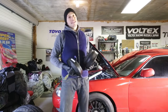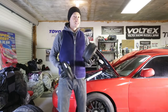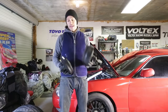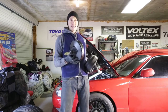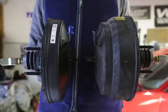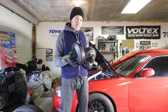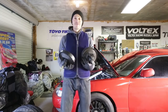While I've got the engine bay empty, I've decided to remove the automatic S14 brake booster. As you remember, I had issues with brake lockup on the track and I suspect they're over-boosted — so this is the culprit. What I've gone out and purchased is a Nissan Sentra B13 — around 1989 to 1994 — manual brake booster, which as you can see is about half the size. It's going to reduce the brake assist, which means increased pedal effort, resulting in more modulation on the racetrack for my big Evo Brembo brakes.